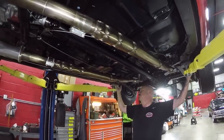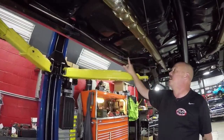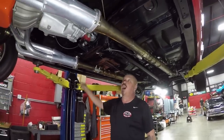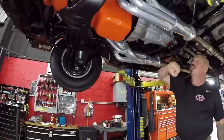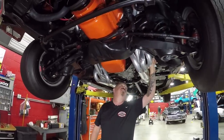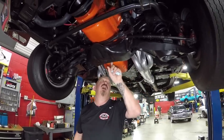I always check the low areas in the frame on these cars — this is a real good area to take a look at to judge the shape of the car. This frame looks great. The fuel line looks good, the brake line looks new, the parking brake cable looks new. Pinch weld looks good. Bottom side of the rocker also looks good — all things you need to be looking at when buying one of these cars. The cross member looks like it's been powder coated. We've got a Muncie trans here with the stock-appearing bell housing and clutch linkage. Looks like all the brake lines, including the distribution block, are all brand new. The cross member up front also looks good — you can see it didn't run into any railroad tracks. It's nice and straight, and these will also rot out on you, so you want to make sure you take a look at this on every car.